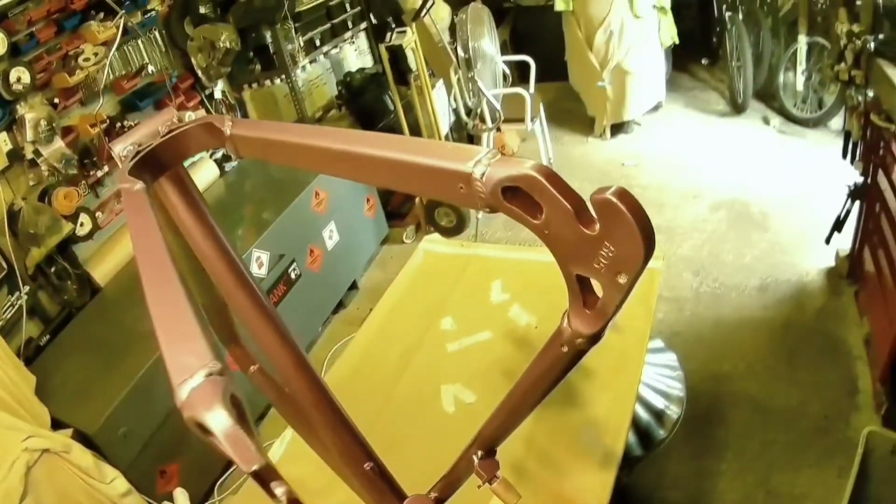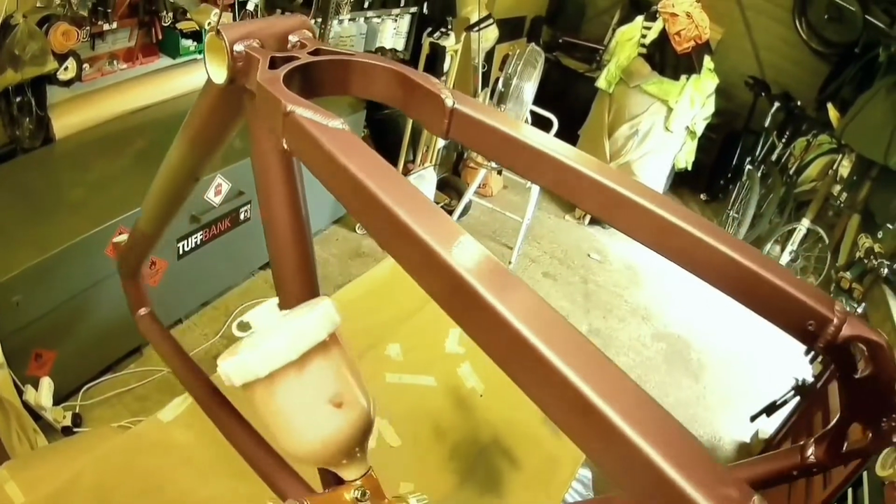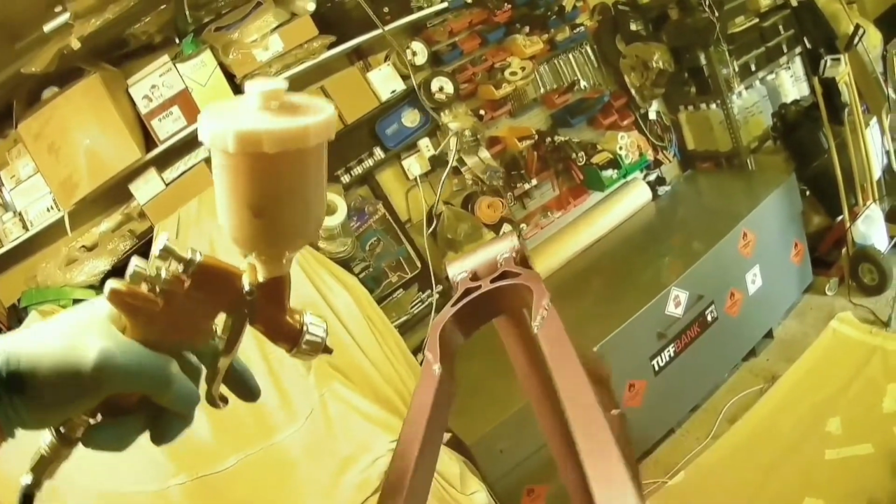And then you sand it down and eventually go over the whole thing with about 800 grit. You don't want to go too fine. If you're just going to lacquer it, you'd go over it with anywhere between 800 and 1500, ideally about 1200, because the lacquer would fill in the scratch marks made by the 1200, the 1000 or 1500, and still adhere nicely. Sorry.